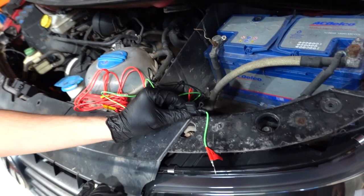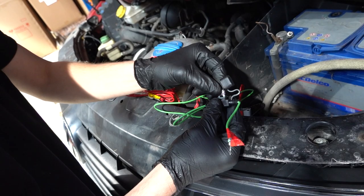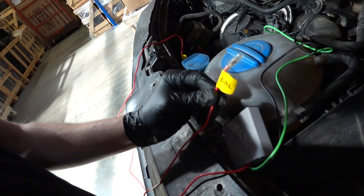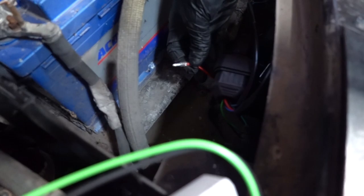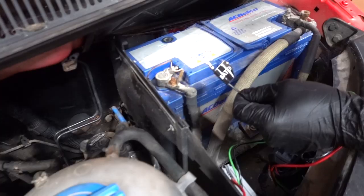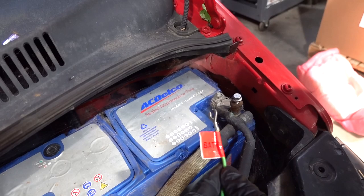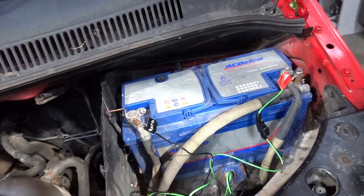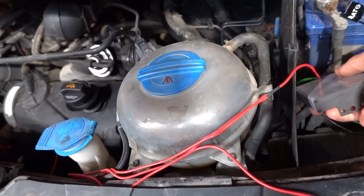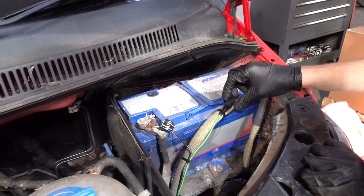So we'll show you how to fit the DRL power pack. We're just going to fit it roughly in this for illustration purposes — ideally you want to run the cables nice and neatly. The first thing to do is take your fuse out. On the power pack you'll see a little red DRL wire, and you'll find the other end of this on the back of the headlights — there's a male and female connection, so just connect those two up and repeat the same on the other side. Next connect the battery negative to your battery, then repeat the same with the positive. Then that's it installed — tidy it up, attach the fittings, put cables out of the way, and cable tie what you don't need.